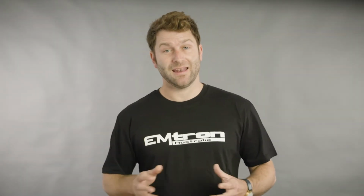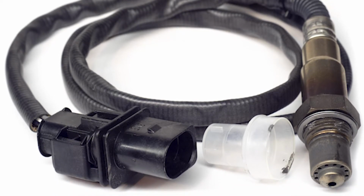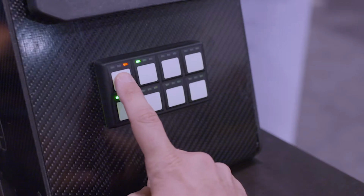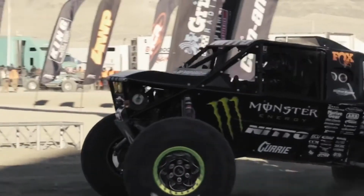It can support up to 4 drive-by-wire throttles and has dual onboard Bosch LSU4.9 Lambda controllers. It has dual 100 MHz processors, 500 megabytes of RAM, and can log 32 megabytes of data with speeds between 1 and 500 Hz. The 4-channel oscilloscope allows sampling at 100,000 samples a second and can be used for crank, cam, or other speed sensor inputs. Additional hardware includes an onboard 3-axis G sensor and a barometric sensor.